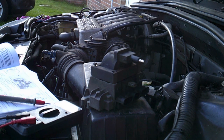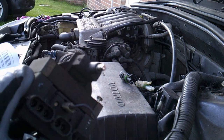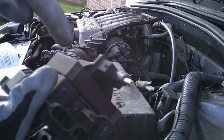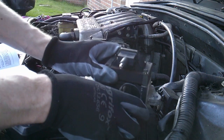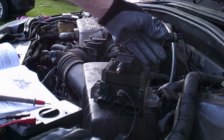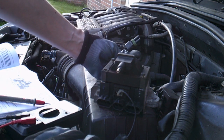So what's the conclusion for today? I think the coil seems okay - all of the ohm readings and everything seem okay. But this - which is the trigger wire - on further checking I don't think that's giving the right voltage.